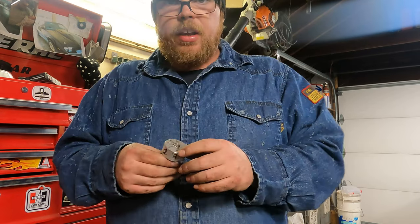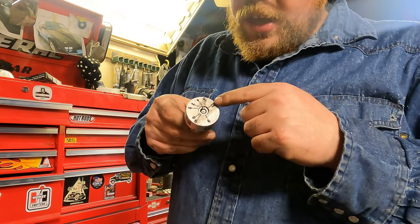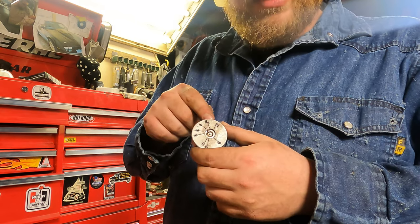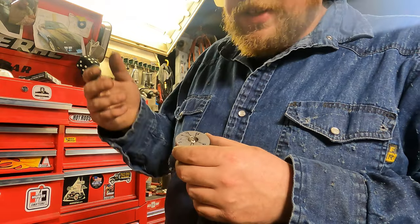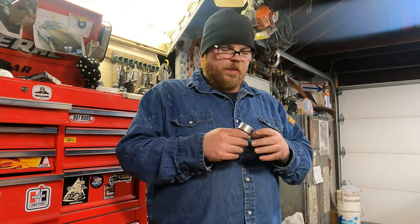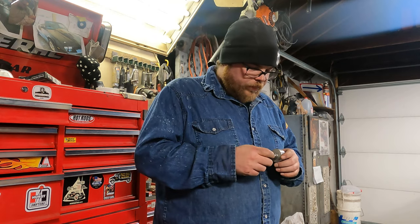You would then just strike your line and write cylinder number 8 right there. And then right on the side of this thing, what engine it's for, so you don't get confused, because I've got like 7 or 8 of these things. But anyhow, so that's all there is to indexing your spark plug in a nutshell. Summed it up kind of quick there.